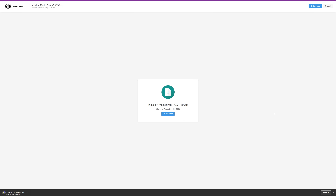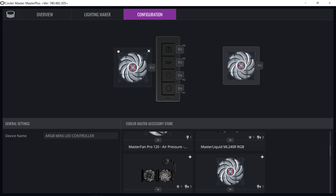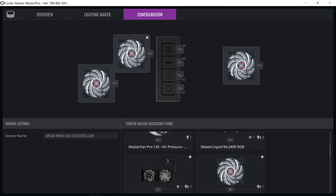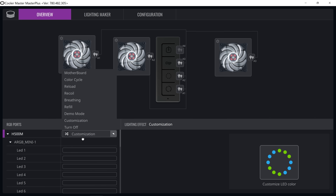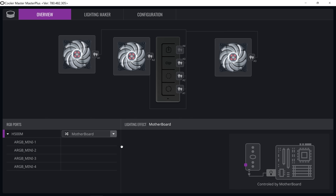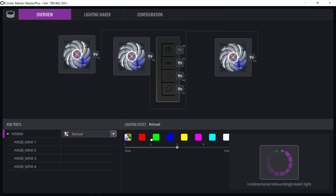Let's have a look at the software. I'll put a link to Master Plus in the description so you can grab it easily without googling. On the software side, both controllers are fairly similar so we're only going to use the mini controller to show you how this works. Locate your fan and literally just drag it in. If you've got three fans, drag three fans in — otherwise if you're using a splitter on the other controller, don't do that. Click the little light bulbs to attach them so the controller knows what to do with the lighting. Next, let's look at the overview to see how all the lighting effects work. I'm going to switch it over to motherboard mode, which enables the motherboard pass-through so you can use Aura Sync, Mystic Light, RGB Fusion, ASRock Polychrome, or whatever addressable RGB software you want. I'll go through all the built-in effects so you can see how this will look in your system.